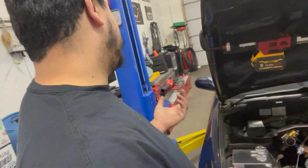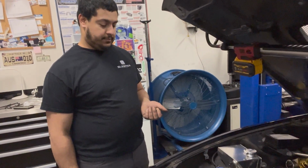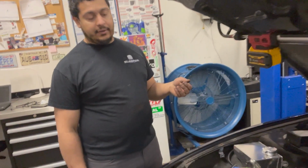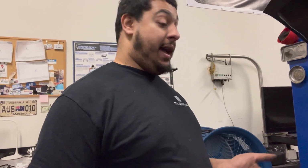Trying to think, I'm pretty sure there was a couple of things. Well, the car didn't run, and it had a bad ECU. Put a Link on it, finally got the car running. Wasn't the ECU melted or something? No. Something happened, a ground short or something? He said he smelled smoke coming out of the radio, and then everything went berserk. I guess something happened with the alternator. The car got like 16 volts or something. Are you afraid that there's melted wires? I haven't even found melted wires.